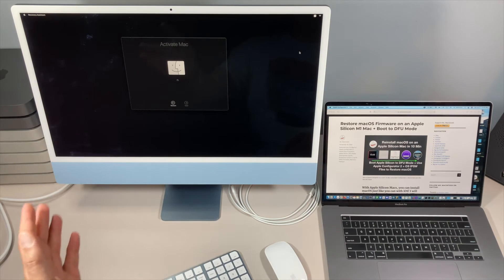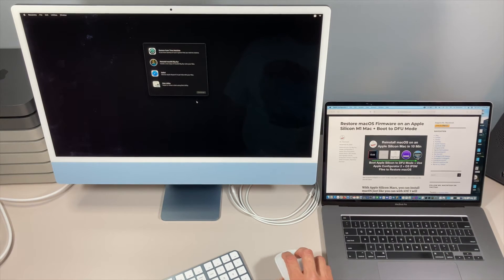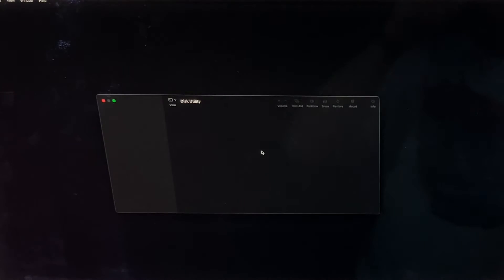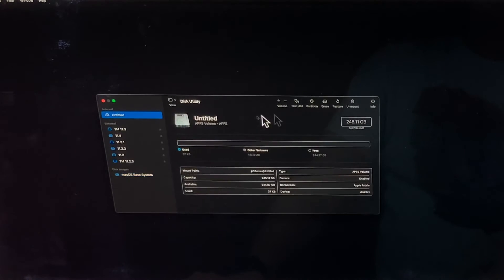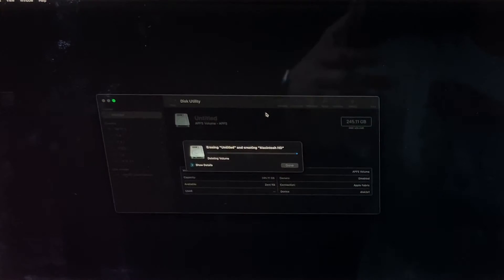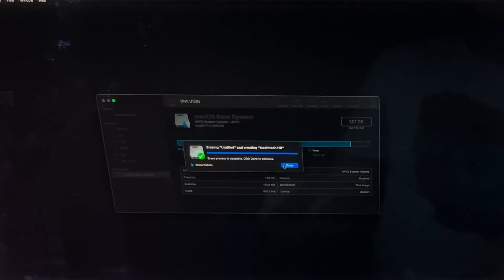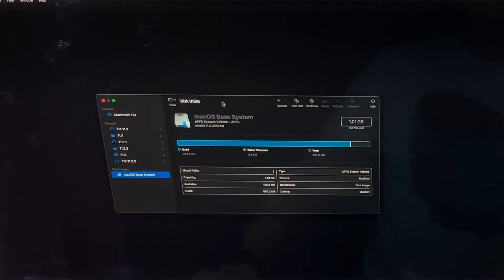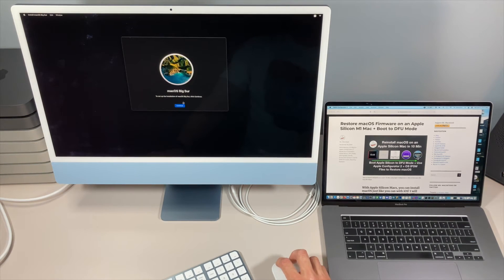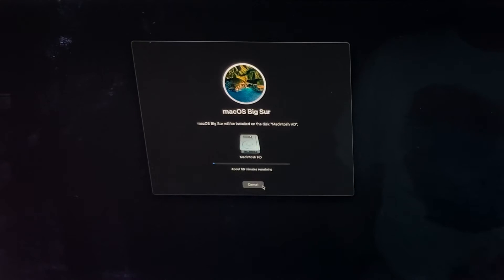Click Next. We're at the Activate Mac screen — connect to Wi-Fi and it's going to activate the Mac. This usually takes anywhere between 20 and 30 seconds. Your Mac is activated — exit to recovery utilities. When we do an Erase Mac and activate, the drive is usually called 'Untitled,' so I like to go into Disk Utility, click on Untitled, and rename it 'Macintosh hard drive,' then click Erase. You can skip this step and rename it later in the OS.